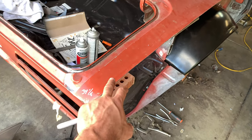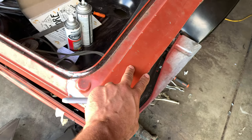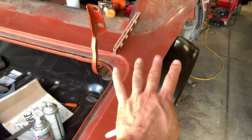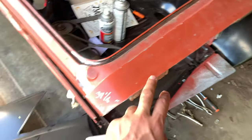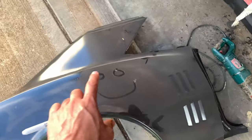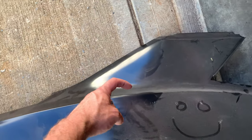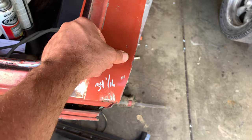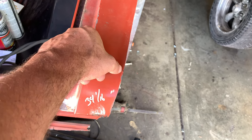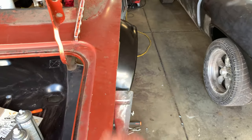The plan is to cut both pieces to fit, and we're going to do a nice clean butt weld. When I came through the ridge I put about a quarter-inch piece of tape to leave myself a lot of material, but it's kind of a rough cut that I don't think I can butt weld to. I want to make sure both these panels are cut exactly the same, so I'm going to cut about a half inch back off the top of this whole quarter panel. That way when I lay it on top, that metal will actually overlay by about a quarter inch. It'll be a little tricky, but I want to try to cut through both panels at the same time so the lines match up exactly for a nice clean butt weld.